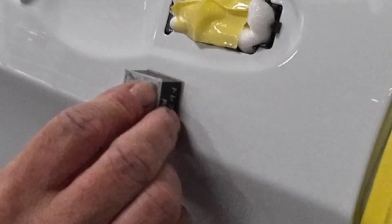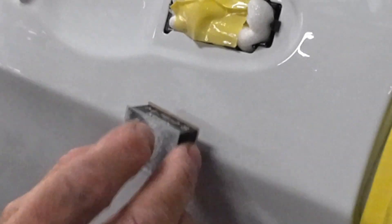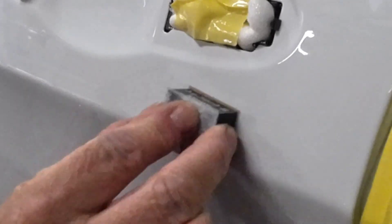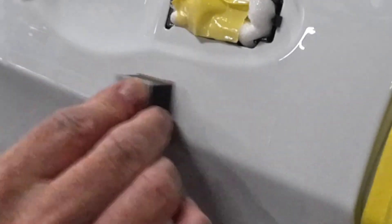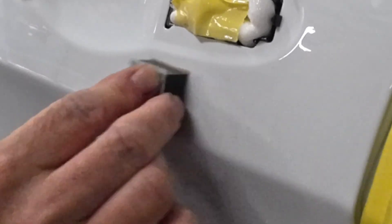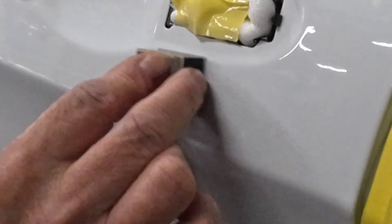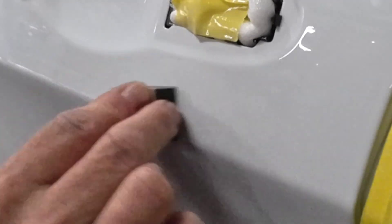So I'm going to hit this with the 1,200 to start off with. Now if they're real deep — which these are borderline deep — you may have to apply a little bit of clear coat, catalyzed clear coat in there, after you wet sand it to totally smooth it out. It could have been from a lot of different things, but it's just a reaction to what was on the surface. Fish eyes can come from things that are in the air as well that land on the clear coat — mostly silicone, really. We're just going to go over it with the 2,000 now, and then basically run over this whole door with 2,000. Then we'll do 3,000 on the orbital sander — the Trizac — and then 5,000, and we'll buff it out.